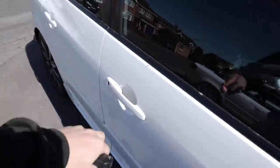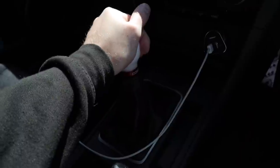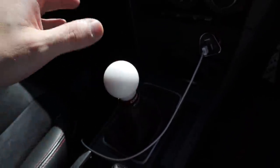The reason I think this car needs it is because there's quite a bit of play in the gear stick. I'll show you — this is a 2008 car so it's not going to be perfect, but there's a decent amount of play in your gear stick as standard. Another thing with these — this is a common thing on Mazda 3 MPS's — when you're ragging it and you go into third it can be a bit stubborn, sometimes you can grind it, sometimes it just won't go in.